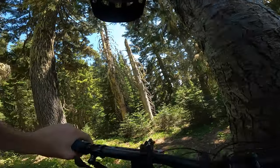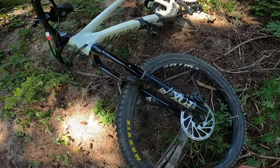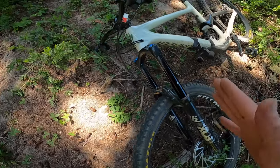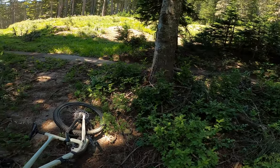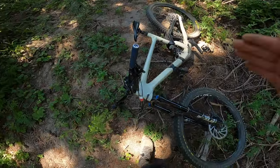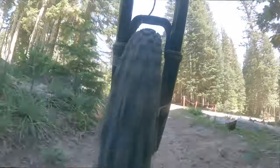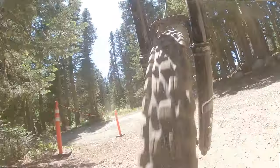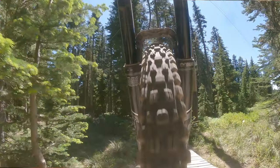Time to pull over and take a break. Was way more confident. Interesting thing — the Fox air spring, the damper, something about this fork gives much less arm pump than RockShox. I let a little bit of pressure out of the fork because I'm at 6,000 feet, and you have to go down in pressure. One notable thing with these cheap forks: I dropped 10 psi and barely noticed the difference. They're not super sensitive to adjustments and air pressure. That's very good for beginners. If you have an expensive fork set up in the wrong way, it's going to feel terrible.